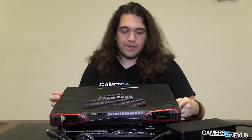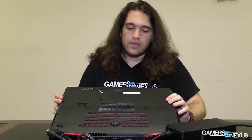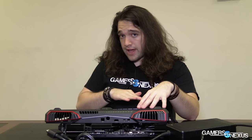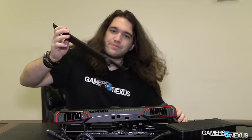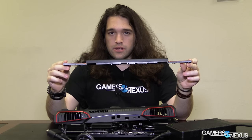There are two RAM slots on the bottom. If you happen to have one of these units — the Fangbook 4 Extreme or the MSI equivalent, since MSI is the OEM — you would basically unscrew all of the obvious screws in the panel. There are a couple of hidden ones too, and those hidden ones are on the other side. If you flip it over, there are two rubber bumpers that sit between the top of the chassis where the keyboard is and the screen when it closes. You peel those off, there are two more screws in there. And then there are also the wings that go and cover the hinge between the screen, the display, and the body.